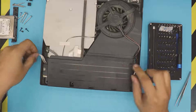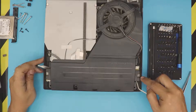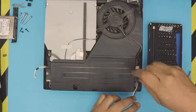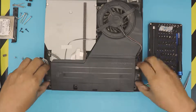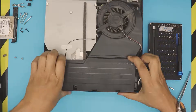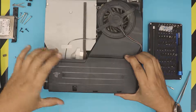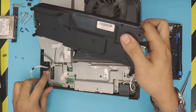Once you have these two cables up, remove the screw on this side and the screw on the other side — there are two Phillips screws. Now grab the power unit evenly from both sides, put your finger right underneath. This side will be loose, but this side has a little jack, so pull it up to loosen the jack that goes right in there.